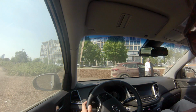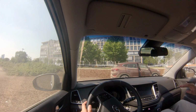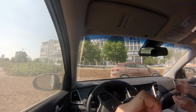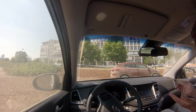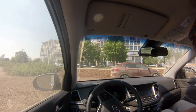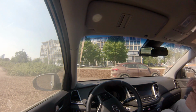It's one of the things that we say when we're instructing that people need to be careful of. If they're inexperienced and they rest their foot on the brake, that hill descent function that you're relying on, especially in a vehicle like this which has no engine braking, is suddenly gone. Most people are just going to press, lock the wheels up, especially if it's slippery, and down the hill they go like a toboggan.